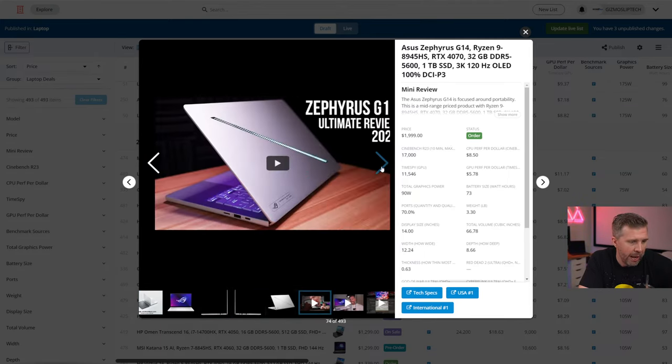So yeah, there's a few options in here, but pretty much the only reason to go into MyASUS is to change your battery conservation mode or to get a system update for a new BIOS. This is one of the areas where you can get your BIOS. Another update area is inside of Armoury Crate. There is the update center. And we can see that we're pretty much up to date here, but you click check for updates and it'll update there. ASUS will also send you updates directly through Windows Update to update the BIOS and other things inside of the laptop. So keep that in mind.